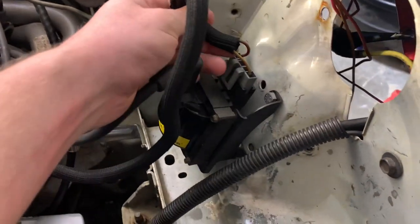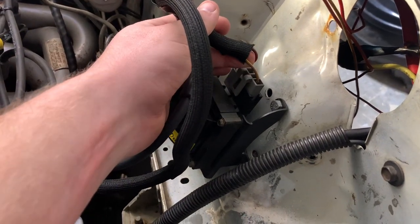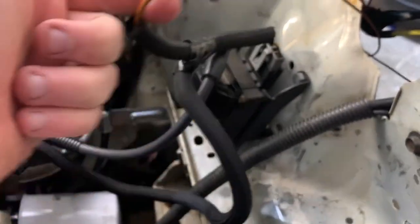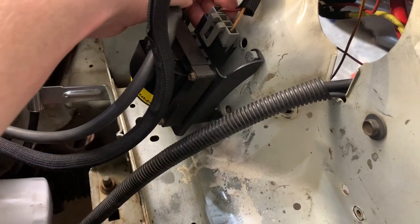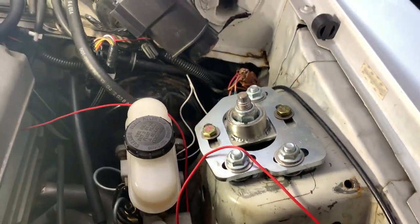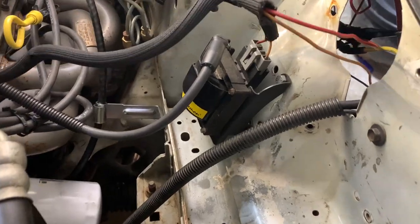Starting at the coil — you're going to have to cut your plug off from your main harness for your factory coil. Some people wire direct to the coil and eliminate the plug, but I chose to keep my plug. For a 93 car, the two wires running to your coil are red/green — 12-volt switched power to the coil — and tan with yellow stripe, which is your tach signal coming from that C110 connector. You just run those right back to your coil. You have to cut this connector off your factory harness to be reused, then run new wires or salvage the factory wires — that's your call.